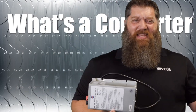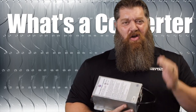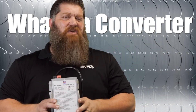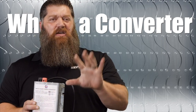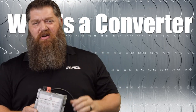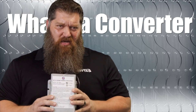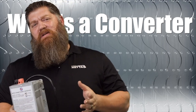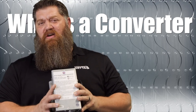55 amps at 12 volts is going to be about 5.5 amps that it's actually drawing. Here's the great thing about it: it typically doesn't break, it's maintenance free, there's nothing we have to do to it. It actually has its own breaker — you'll find it in your breaker panel box as an independent breaker simply labeled 'converter.' Typically it's about a 15 or 20 amp breaker. So when you're considering how much power you're using, always consider that you have that converter on.